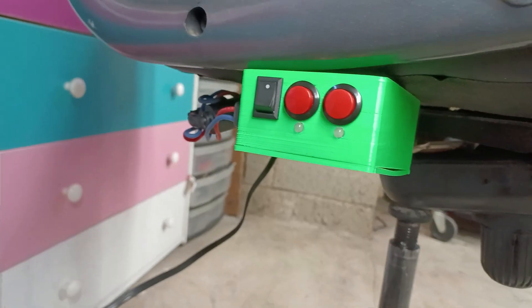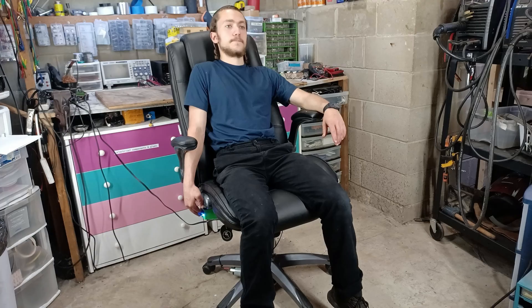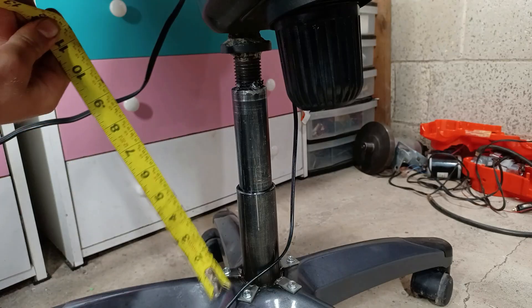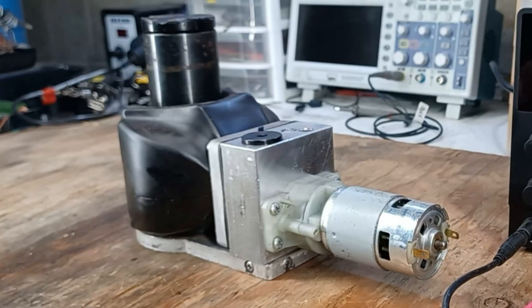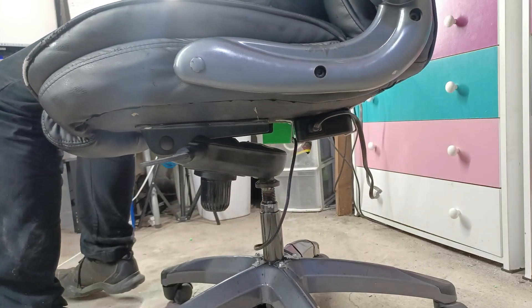Now that everything is complete, let's test it out. By flipping on the power switch and pressing the first button, the office chair will start going up as long as I keep pressing it. It goes way higher than before — which used to be a maximum lift of 3 inches — and now it has a maximum lift of 8 inches, which is almost 3 times the original height. And also, if I don't fully pressurize the cylinder, I can still spin around like before. Now, while it still takes about a minute to go up or down, my solution is that since this hydraulic pump has a speed-reducing gearbox which allows the jack to lift up to 2200 pounds, we can just bypass the gearbox — that should give quite a bit more speed, which I'll hopefully be able to do in the next video.